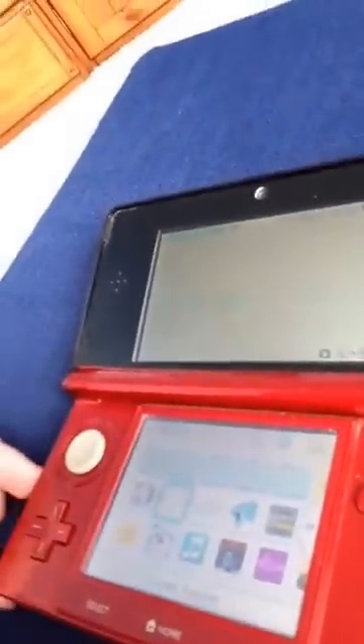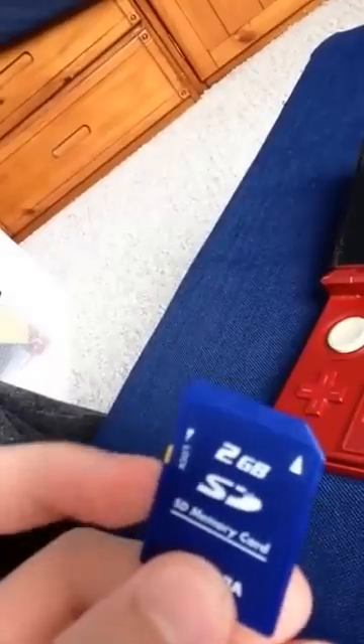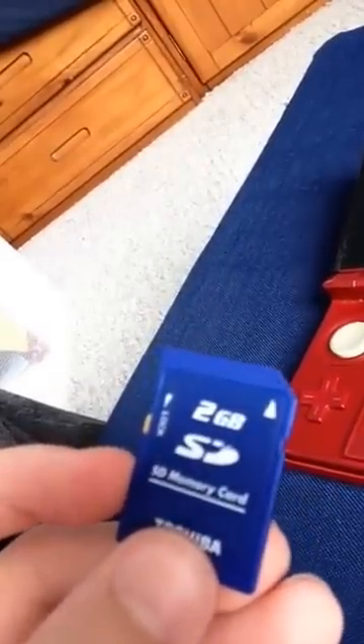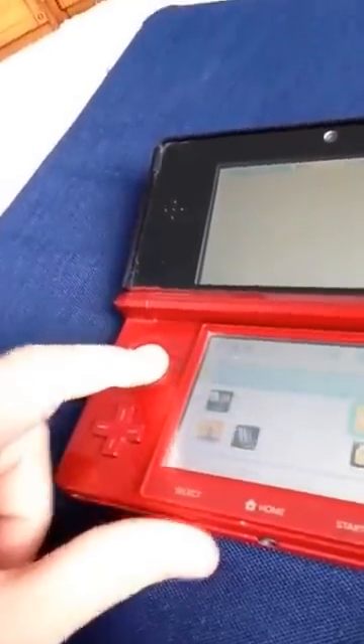So yeah, I popped it out, press okay. Take out the SD card and look — it might be at the bottom, which is either lock or unlock. If this little yellow knob is at the bottom of the word lock, then that's your problem. As you can see, my 3DS is still on and my tray is still open.